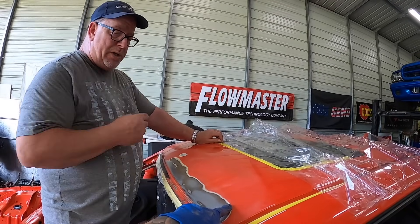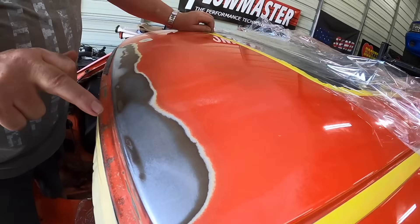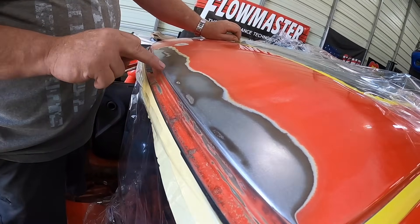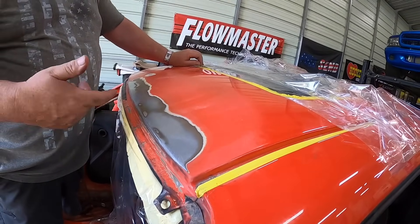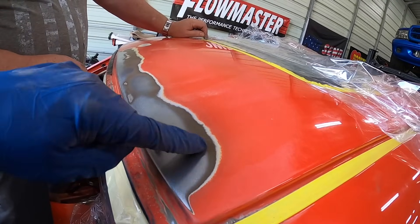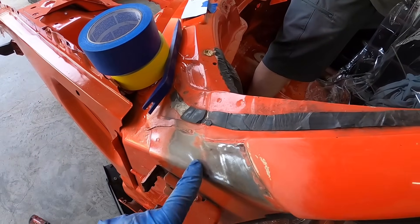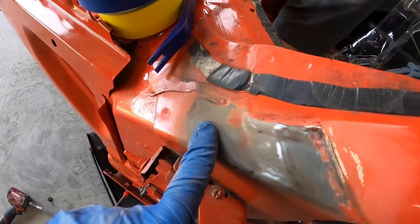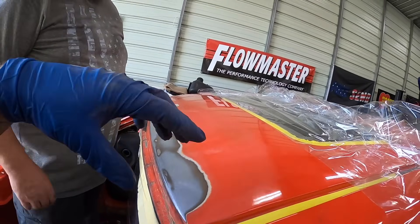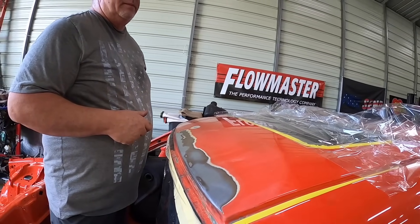Something kind of unique — in the front we really didn't see white primer, but up here on the base of the car we actually see white primer. And where the roof line comes to the curvature, you actually see factory body filler. Looks like they skim-coated in a few places — it must have bent when they molded the pieces together and had a little crease. You can see factory gray primer, then white, and then they laid the orange on top. So we're going to follow the same process: self-etch primer, then white primer over top, sand that all in, and then we can go to orange.